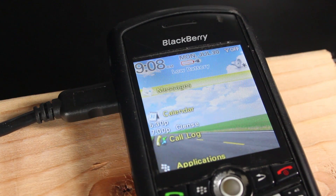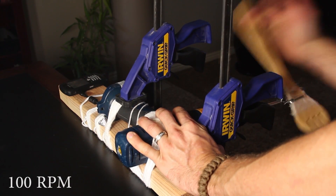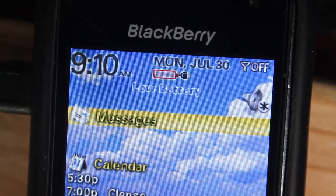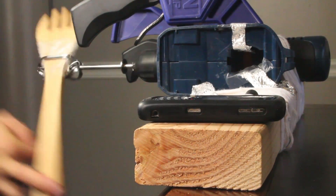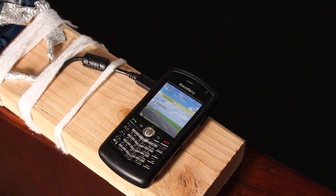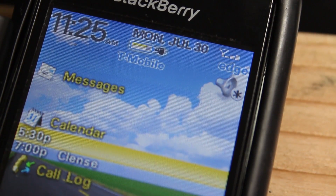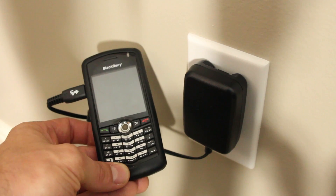The crank handle gets inserted and the system is powered up. The charging symbol is flashing, which means I need to crank just a little bit faster for stable power. I'm cranking this at about 100 RPM to develop the 5 volts this phone needs to charge. If I crank slower, the phone won't power up. And if I crank too fast, I risk damaging it. Just for the challenge, I'm going to see how long it takes to recharge this battery from a completely discharged condition. It seems to be taking quite a while, but it takes quite a while even when it's plugged in with a charger.